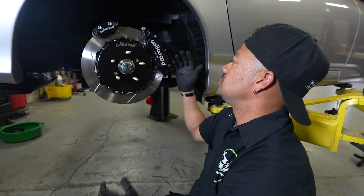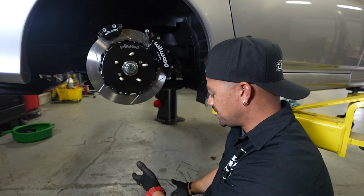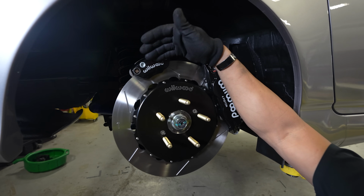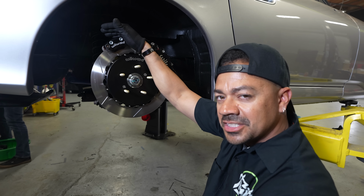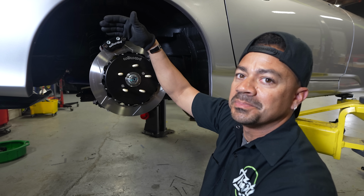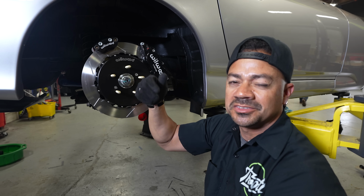much. Now, when you upgrade to something like this, you lose your e-brake, right? Because you have to replace the caliper for this huge one. And that's where this one comes in. This is our new electric parking brake. So this little caliper here, its only purpose is that once you're at a complete stop and you press a parking brake button, it literally just squeezes and holds it in place, which is essentially your e-brake, but digitally.